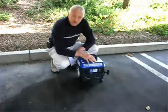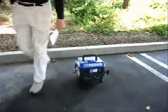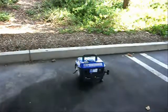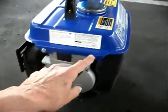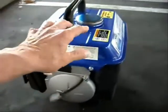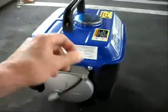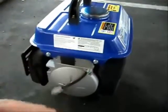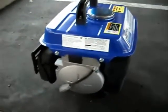I'm going to go in for a closer view. First thing I did was unbolt these two bolts — they're 10 millimeters, and there are two more on the other side. Then you raise it up and check the fuel line: the connection at the top and the connection at the bottom. Make sure they're secure and the little clips are where they're supposed to be.